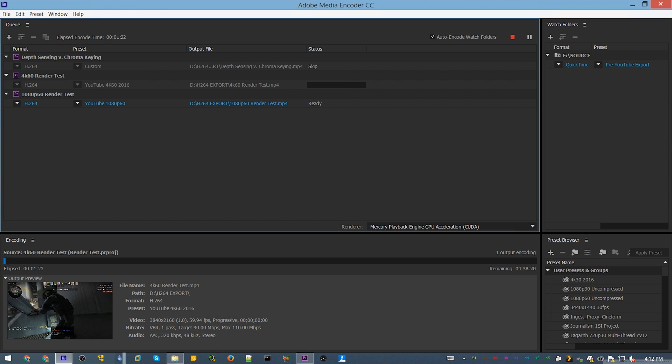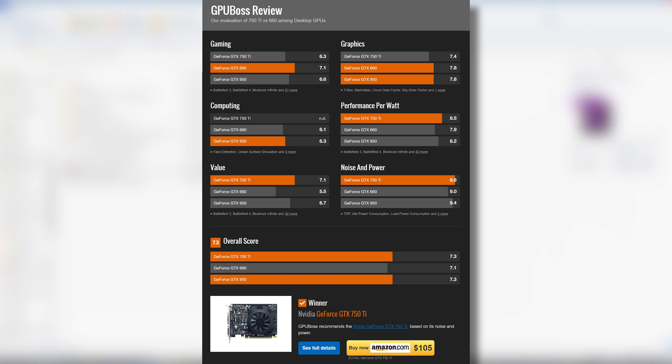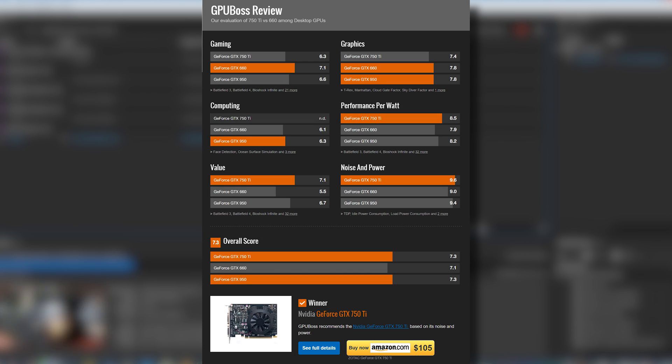It's been quite the interesting day of experimentation and trial and error, to say the least. I ran a couple render tests on the GTX 660 to get a baseline of render times to compare to the 750 Ti. I originally said it'd be a little bit faster, but it's actually not. The 750 Ti is a little higher clocked but has a bit less memory bandwidth, so it's more or less going to get the same performance in this rendering environment. But for a much cheaper card — I paid closer to $200-something for the GTX 660 — the 750 Ti is about $120 new, and it has 4GB of VRAM versus the 2GB on my 660.